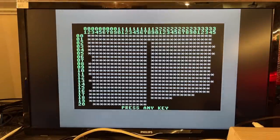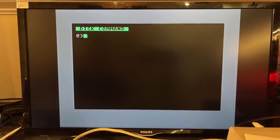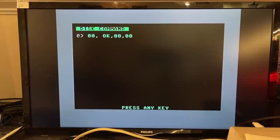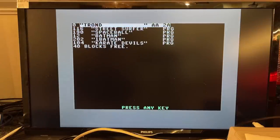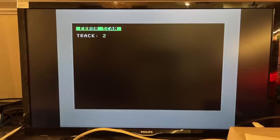This command screen — I'm not sure what commands you can type here, if it's the same as the OPEN command in Commodore BASIC. I typed V and I think that's Validate — it validated okay. I guess if you type N you can format, D is directory. And then Error Scan — this will search the floppy disk for any errors. Zero bad sectors, that's good.